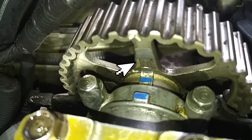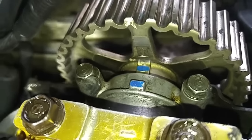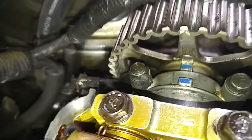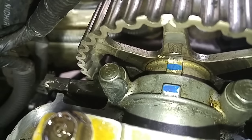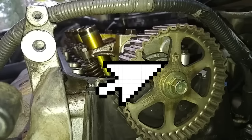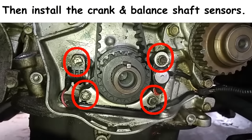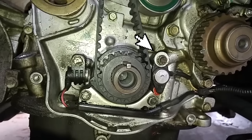The arrow mark should be centered against the alignment mark over here, and it coincides with the 'up' mark. I put in a washer with JB Weld on the other side to reinforce the connection between the ear and the body of the sensor. I also put RTV at the bottom portion of the sensor where it mounts up against the engine block.